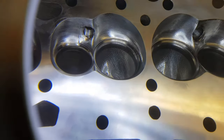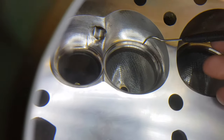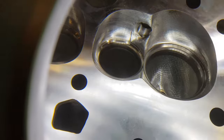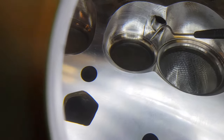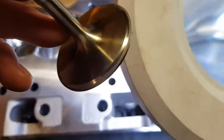I'm not sure this will go through the magnifying glass that well, but you can see pretty well. The gray line here - I've just lapped this valve in and that's spot-on, just a little touch and there's a gray line. It's a bit hard to see, but this one here is the seat. It's an intake one - and here is the exhaust one. It's hard to see, but more importantly is what we're seeing on the valve.